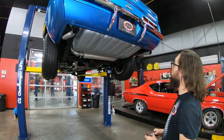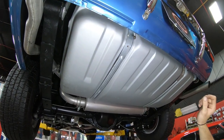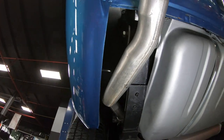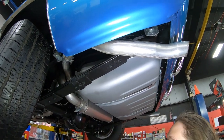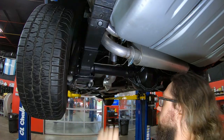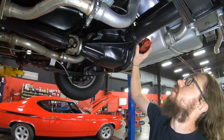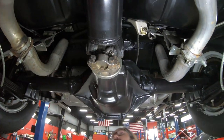We've got our 1969 small block Camaro up on the rack. First thing you're going to see is a brand new fuel tank, brand new straps, brand new insulator pads underneath. I can tell that it has had a trunk pan put in it — they did really nice work, looks like an entire unit put in one big piece and the workmanship looks to be pretty darn nice. There's a set of brand new shackles with brand new shackle bushings, and moving forward on this car all the bushings look to be very recent. We have isolator pads on our leaf springs, the springs look like they're in really nice shape, all the clamps look good. The underside of this car is very pretty and all the sheet metal work is really nice — you can see the seam where they stitched this trunk pan in, once again very nice workmanship.